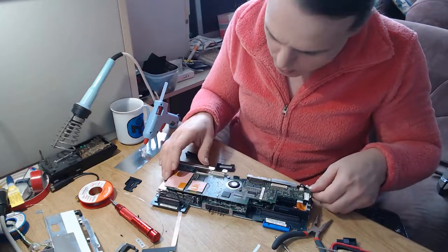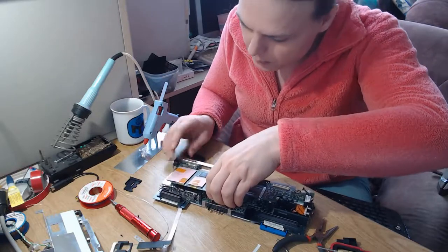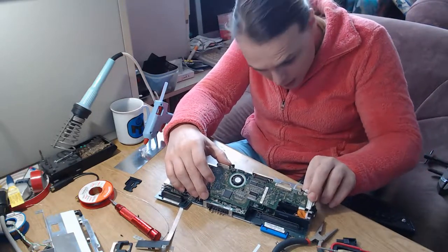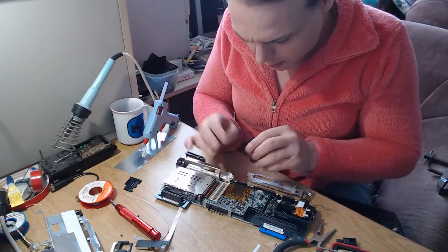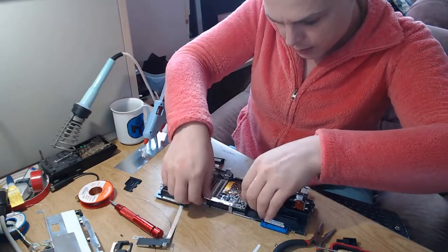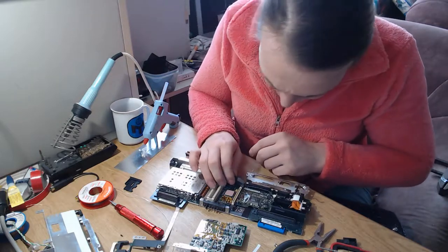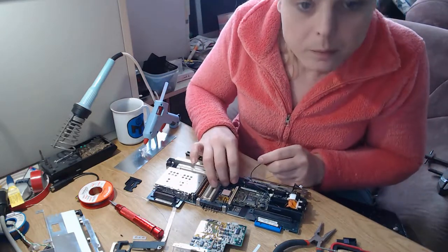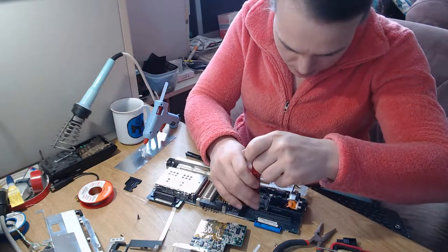Looks like this should sit down there with the voltage regulator card. So I might have to remove that again, because this should be down there. And the problem is if I screw it back together and there's one of these spacers missing, then I might flex or even break the PCB. Yeah, this has to go down there. Like this, but it has to go below the sound card.